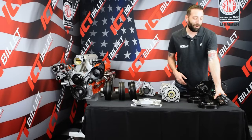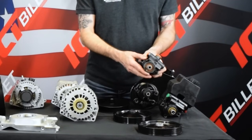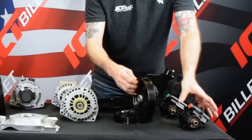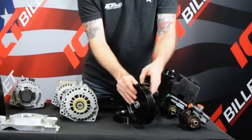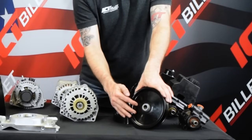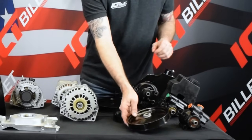We're looking at power steering pumps now. This one has the smallest shaft diameter — this is out of a Corvette. Notice that it doesn't have a reservoir mounted on it, so it's not quite as universal to use in most swaps. The pulley has very little projection, so it's pretty tight to the pump. This one here has a plastic pulley used on the older Corvettes with LS engines. The newer ones were steel with spokes — it looks a lot nicer, but they're interchangeable.